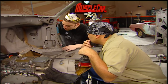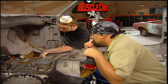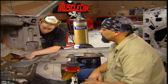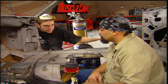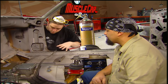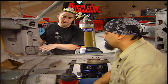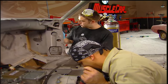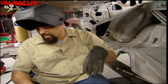We were talking about bracing that wheelhouse with an inch and a half tube. We could drill a perfect inch and a half hole and come through here — no one will ever see it, and we can access it. Then we'll just weld around that hole on the other side, so it'll be like a perfect fit. The tube will just disappear inside the frame. When this is removed, we can put that plate on the back like we were talking about, weld it to it, put the floor back on, and people will be like, what happened to that tube? It just disappears.